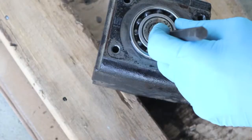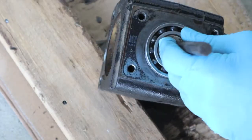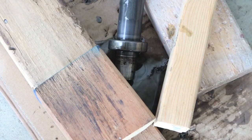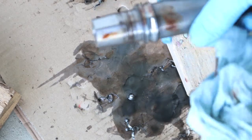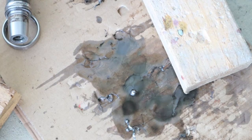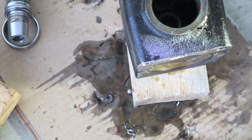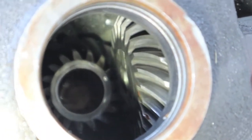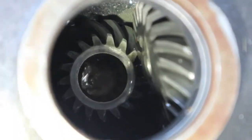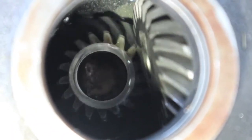There's a spacer on top of the bearing. Now we get in there and see the condition of the gears. One thing that concerns me about the shaft on the bottom output end — it's got a pretty good groove in it. That's the bearing race. That looks like a small bearing for that output shaft. I was hoping to get some numbers off of it — it's NRA, made in Russia. The gears look real good though — there are clearly no teeth missing, though they're not wanting to turn well right now because they're not supported by the shaft.